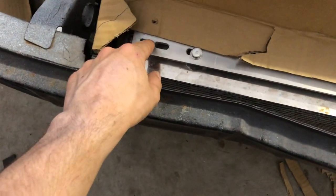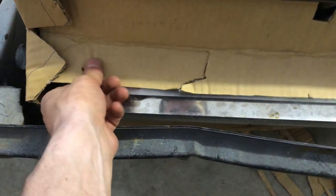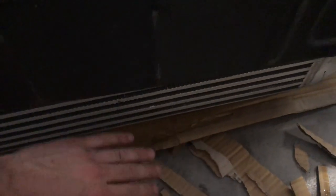Just messing around, nothing's final — just seeing how it works. I'm going to bolt to that and let that go right there, fold these over and attach them to each other. This goes all the way up, so now air coming through the bumper goes through the intercooler, oil cooler, and has to go through the radiator because it's blocked, for the most part on both sides.